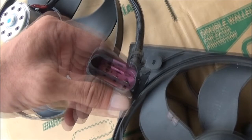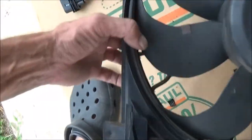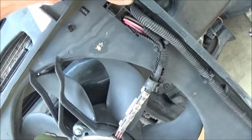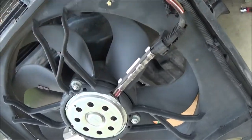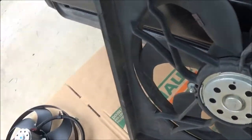The thing I was going off at the store is the plug. This one has three male ends, that one has three female ends, so you can't get them confused. You'll have to take this little black piece off right here to get your wires out. Then you just have to take these three bolts out, take your fan off, and put your new fan back on.